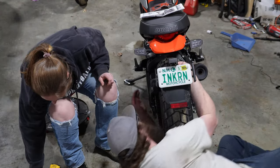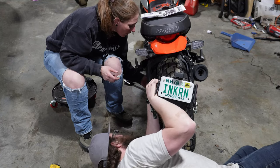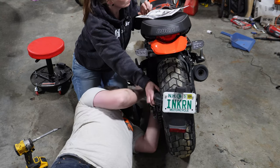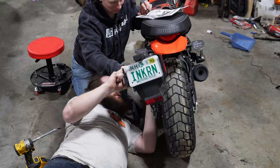Now we're going to just have to see where this cable is getting caught up. There's some kind of cable clip right here — I can't really see it all that well. That's disconnected. Now we should be able to pull this rear fender off just like that.